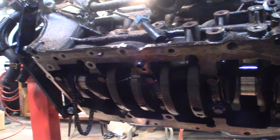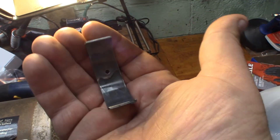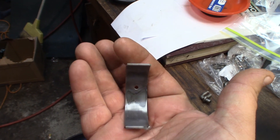The crank actually looks pretty good. The journals on it look great. I had a bearing out here for you to look at — here is one of the bearings. It's not worn down to the brass, it's really not in bad shape at all. There's just a little sign of wear right at the bottom there, but those bearings look really good. They all look about like that or maybe even a little better. I'm happy with that.